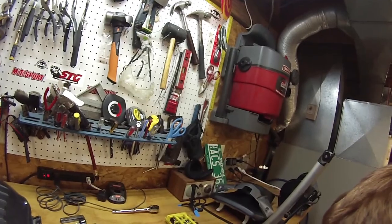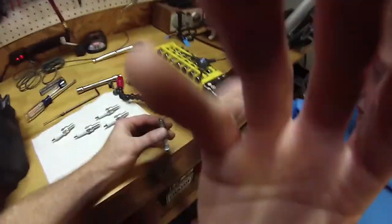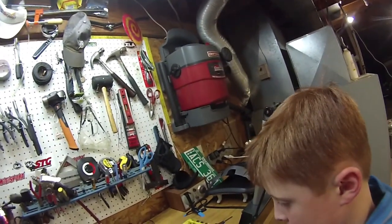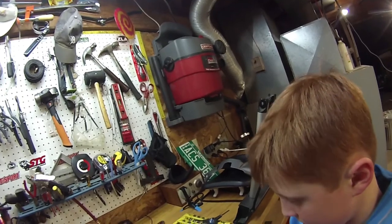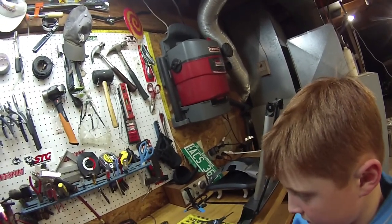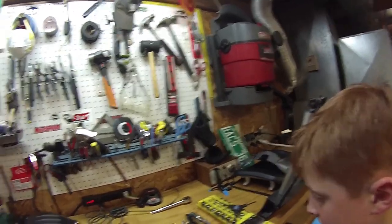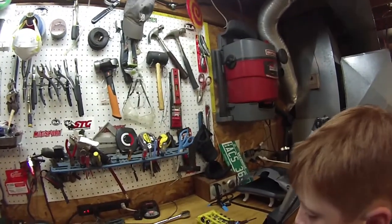What color is that? It's a little tan — which means a slightly rich mixture. But I'm glad about that; it used to be bone white and I've worked on it some. You've got to be super careful because you see that needle on the end and this electrode that comes up — they are perfectly gapped a distance apart from each other that they need to be. So we're going to be really gentle with those and not drop them.